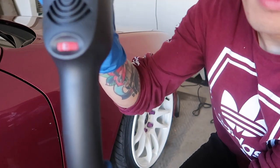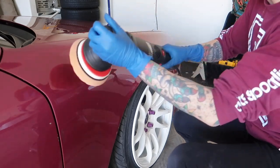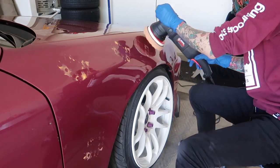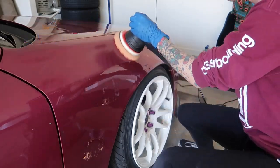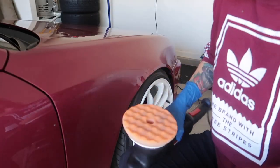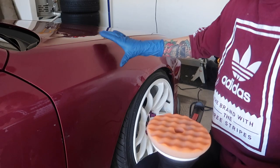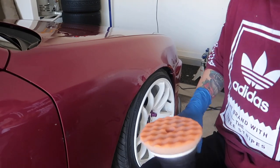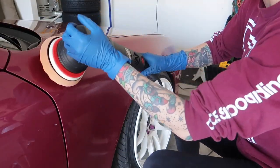Use some detail spray and give it a light mist. Then put a good amount of compound — about four dots, not too big — and just work it in. For me I just start on number three at a low speed, just kind of apply it in little areas. Then with your slow speed setting just work it in. When you're polishing, take your time, go slow, go horizontal and also vertically with 25% passes. Then bump up the machine — mine goes up to six but I normally keep it at five — and that's when you just full send.